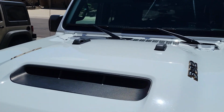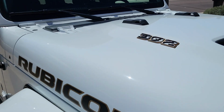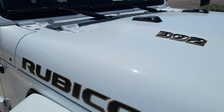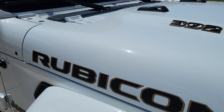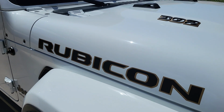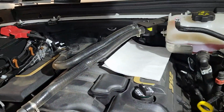I do 3 things in addition to the standard procedure. Number 1, I use half a liter of fluid as a final flush after the drain. Number 2, I lubricate the new oil filter's threads as well as the gasket. And number 3, I park the car over a piece of cardboard overnight, fresh clean cardboard, and check for spotting in the morning. First thing to do is start out at 5,000 miles.